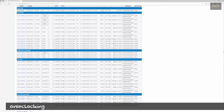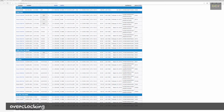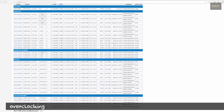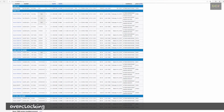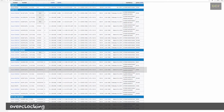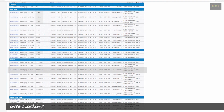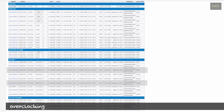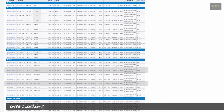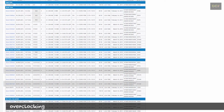To lower the possibility of troubles, I recommend Xeon CPUs with a high multiplier, so the base clock of the board can stay lower and increases the stability of the system. The X5650 I am using has an all-core multiplier of 22, including its turbo boost. An X5675 has 25 and the price, about €55 each, is reasonable.